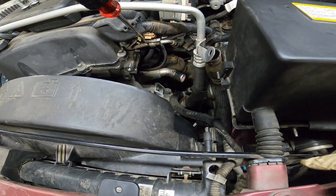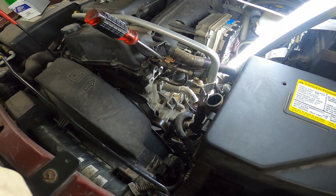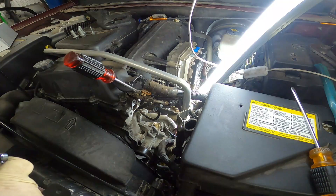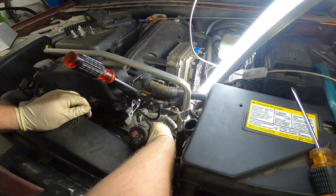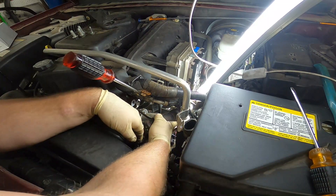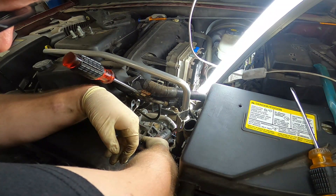I've got my low-side hose tucked out of the way — try to keep as much coolant as possible. We're going to go after these 10mm bolts: one right there, and the other one on the opposing side, kind of down below. I'm going to see if my 3-inch extension with the deep 10 will reach that one in the back. I think I might need a 6-inch extension — but I just made it.